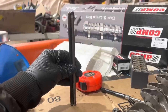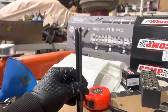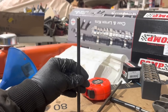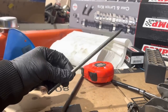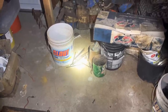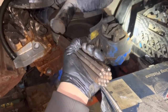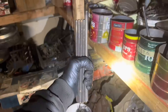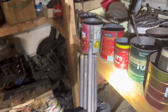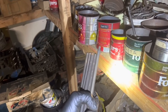On the right, a shiny new pushrod from this engine. On the left, a random old one I found on the ground. Notice the pushrod out of the engine actually does have one shorter end — apparently that's for an earlier engine. Some of these rocker arms have smaller cups, but ours don't, so these were already wrong. We knew the pushrod was right around eight and a half inches, and checking it with the measuring tape said sure, it's really close, but it's not close enough. This is what we need. I'm going to go see if I can find 15 more of them and clean them. Just for the record, we didn't build this engine, so not our fault. Please let them all be in this random pile on the floor. There are actually 18 of them — well, better than 15. Just in case you were wondering what a 440 pushrod looks like compared to a 383, like that, and that one's got the smaller ball on one side so it must be an earlier engine.